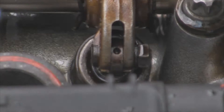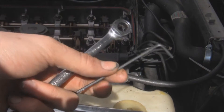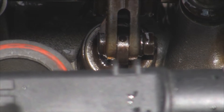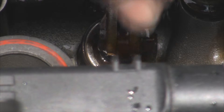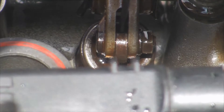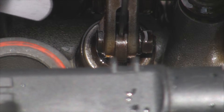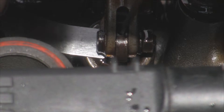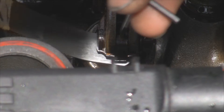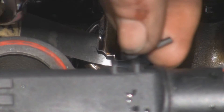You need a little drift — I use a 2.5mm Allen key that fits in the eccentric hole. This job goes a lot faster with two people, so you can have your friend tighten the nut when you're done. Leave your tool in there, then use your feeler gauge right in between the rocker and the valve. Adjust the eccentric until you get that feel where it's not too tight but not too loose. It's kind of an acquired touch you'll learn over time.